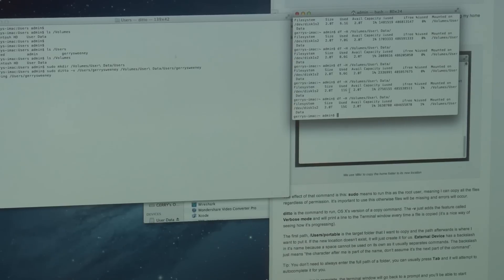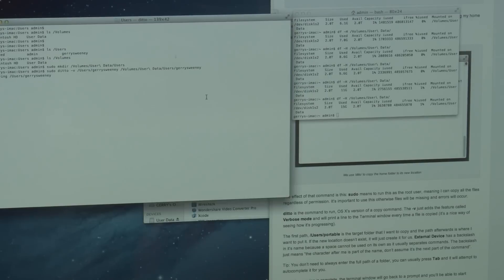I've let that run for five minutes — it started at 7 gig and got to 15 gigs. It's doing about 8 gigs every five minutes. That's going to take absolutely forever. So I've been thinking — I have a full backup on the Time Machine. What I'm going to do is stop this, put the two drives into the computer, boot off the new operating system, switch the user account to the second drive, then run the migration utility. I'm going to abort that copy and clean that drive again.